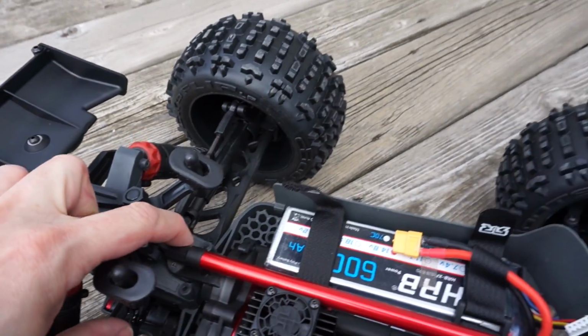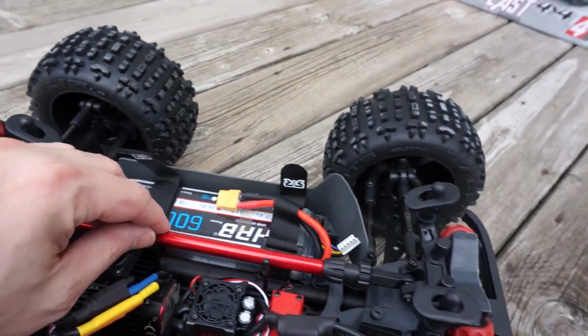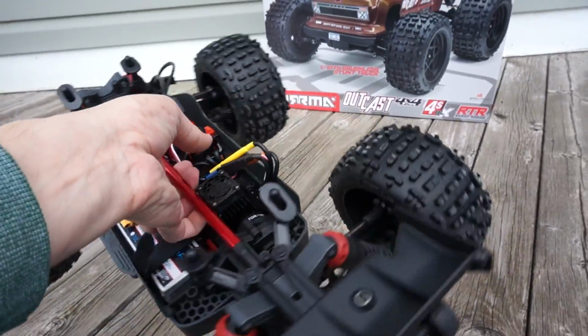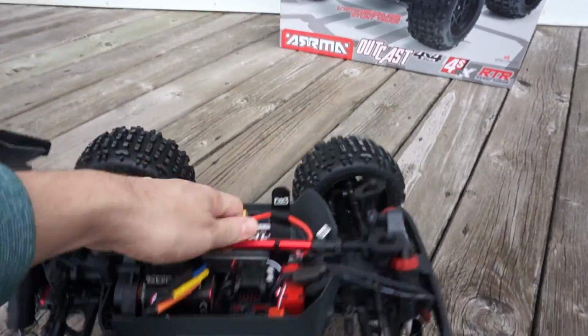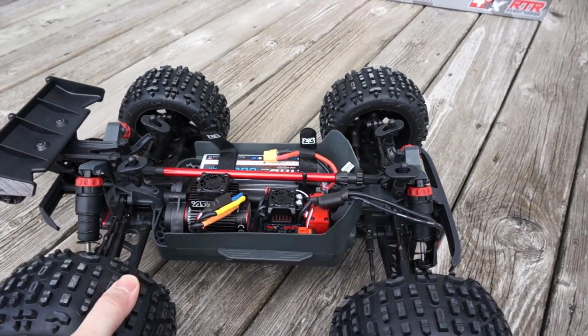I do like it. It's got plastic end links so that if you do get in a horrific crash, the end links will break and you won't have to replace the bar. And we'll see how this holds up for longevity. But I always like these bars on vehicles. I tend to put them on some of my other race cars because it makes for great transport, and it does certainly add rigidity to the chassis, which is noticeable for driving dynamics.